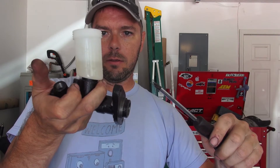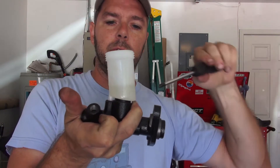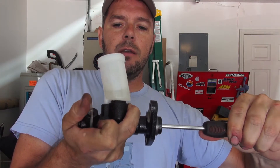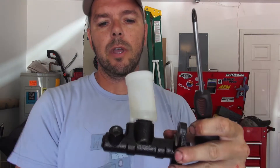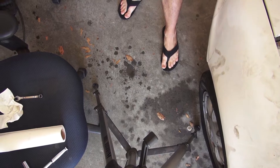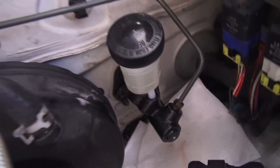You're going to press the piston in, put your thumb over the hole, and then let go — what it's doing is pulling fluid from the reservoir into the system to purge the air out. You push in again and fluid squirts out. That's it — now there's fluid on my fingers, which is what you want. Put the hard line on it so hopefully it'll stop leaking. Alright, brake fluid on the floor, bare feet — master cylinder is in.